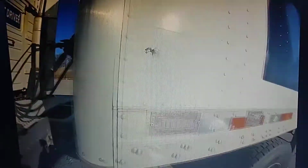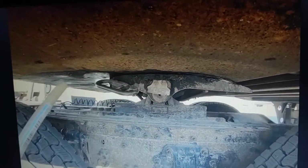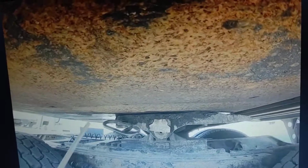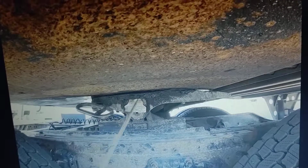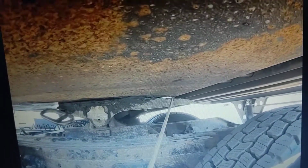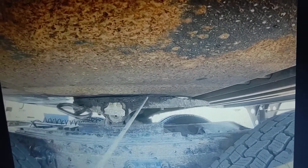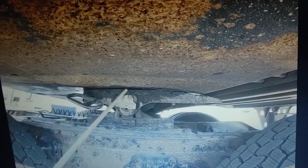We're going to come underneath the truck now, and then we're going to inspect the coupling components under here. First, we're going to start with the apron. Apron is the bottom of the trailer that meets the fifth wheel skid plate. The apron we're going to check to make sure it's not cracked, welded, missing any pieces, or broken. We're also going to check our fifth wheel skid plate to make sure it's properly greased, it's not cracked or missing any pieces. We're also looking to make sure that there's no gap between the top of the fifth wheel skid plate and the apron itself.